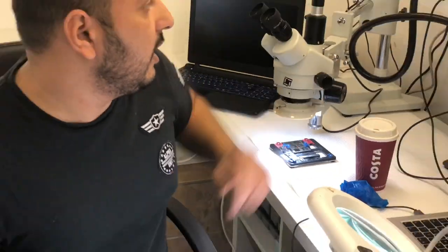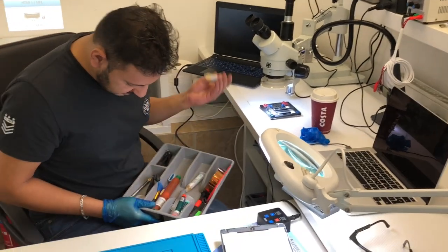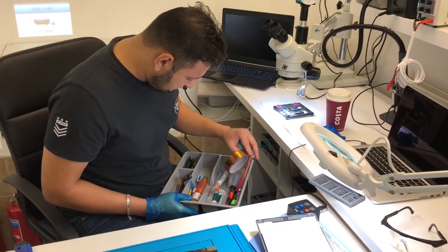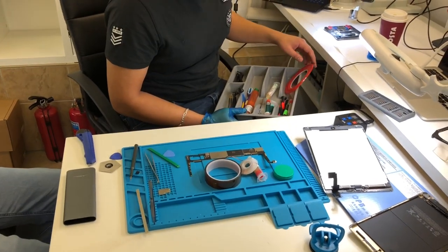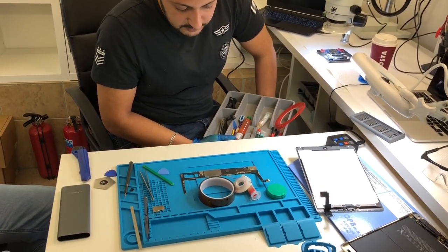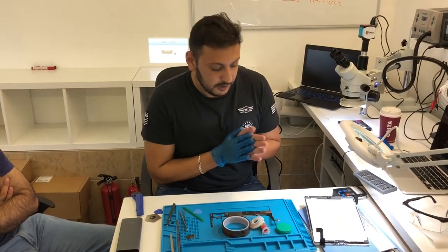The tools you require for the charging port micro soldering job: you need a hot air workstation, a soldering iron, soldering wire, flux paste, a desoldering wire, tip cleaning paste, and a nice tweezer, plus anti-heat tape. I'll make another video on this one - I'm not going to start it now as this is already a long video. We'll put this back together and start working on the next video for the motherboard repair. Bye for now!